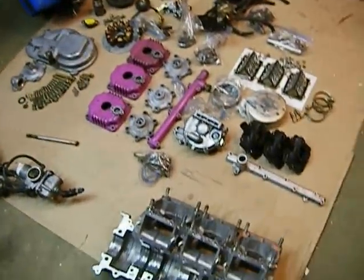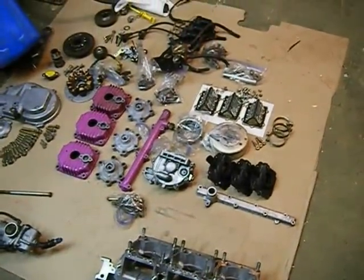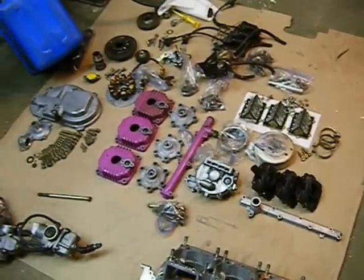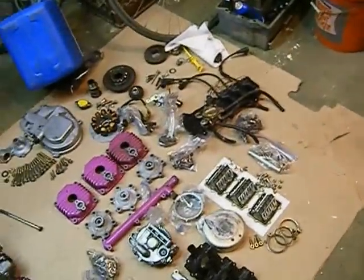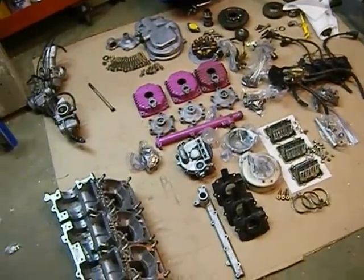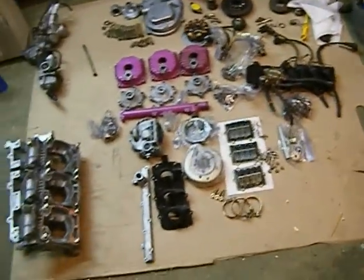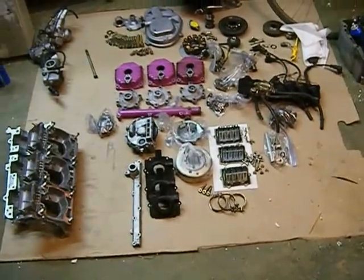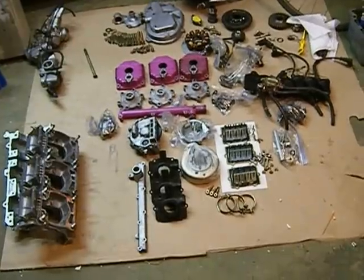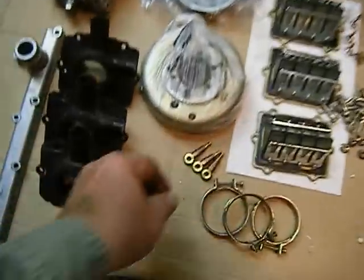The engine is going to be what it is. I'm not going to put a lot of money into it, but I'm going to try to make it dependable. I'm going to fatten it up definitely, so it's not going to run so lean. I'm going to disconnect and do away with the oil injection, which in my opinion — and it's only my opinion — isn't very good.